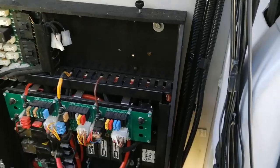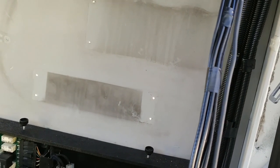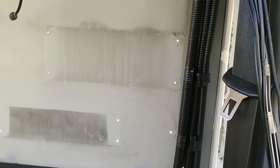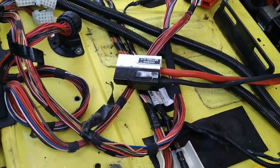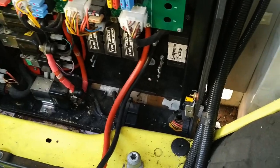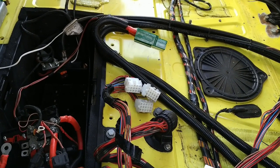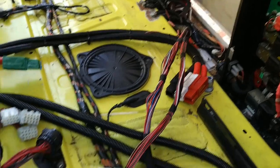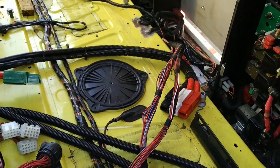I've removed the aluminium checker plate that ran top to bottom there to reveal this cable harness, and that allowed me to start pulling out these cables that go over the headlining and all the cabling that originally went to the CCTV and other comms-related units. The wiring harness on the floor has a round multi-plug interfacing with the multi-plug down there and three connectors — those went to the original ambulance radio. That side of the wiring harness is completely redundant and could be left or stripped out.